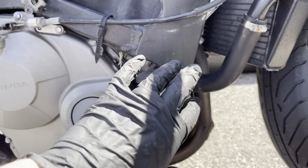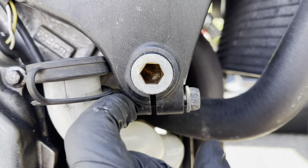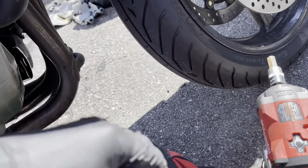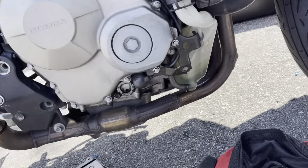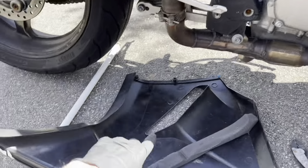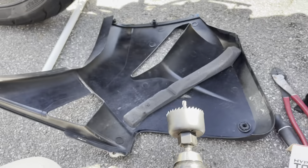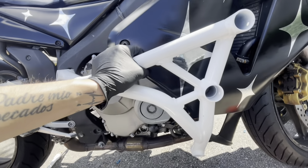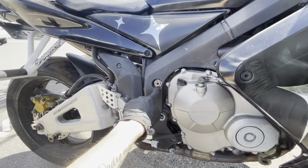The first thing I'm going to do is take out the motor mount. You have a 12mm bolt here that clamps the frame together, and then a 10mm hex bolt which I busted out with an impact, and then a nut on the back side. There's a spacer in between — you're going to keep that in there for now. I already marked the spot on the fairing where I need to drill through. I have a two-inch hole saw and it looks perfect. We now have our second hole made on the left side.